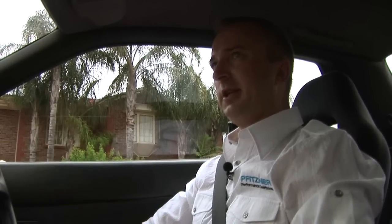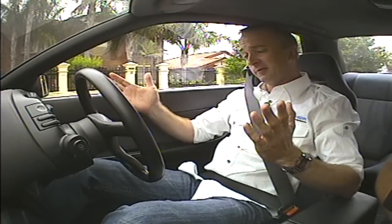My recommendation to most people is at your traffic lights, when you're ready to go, put your foot on the clutch, count one, two, three, into gear. Nine times out of ten you won't even hear it go in. So fingers crossed, try that. One, two, three — small clunk and we're off.